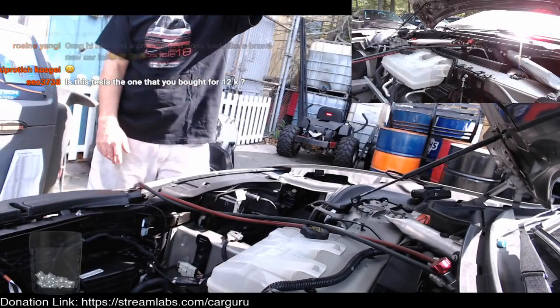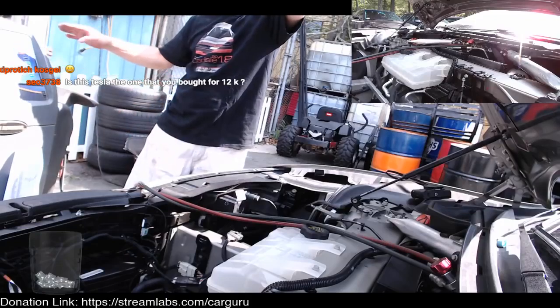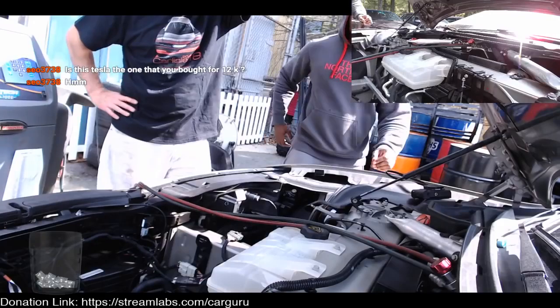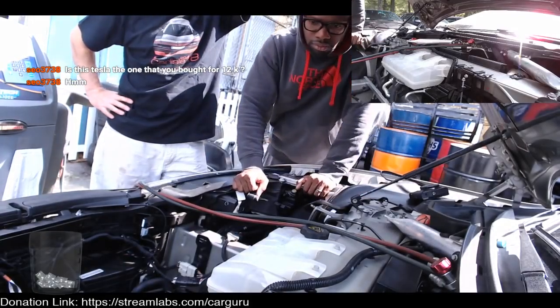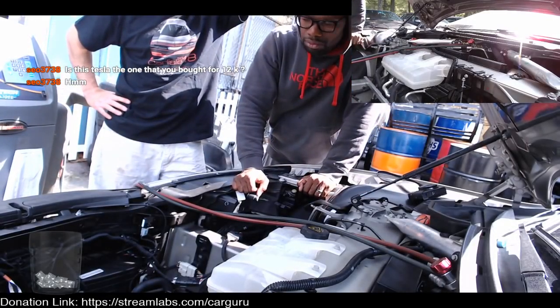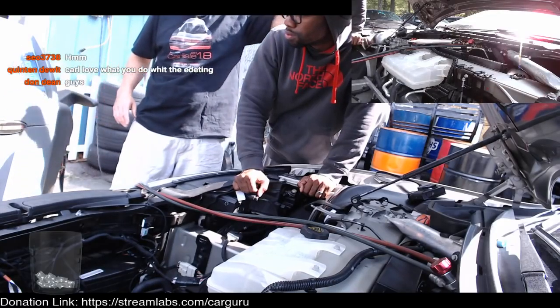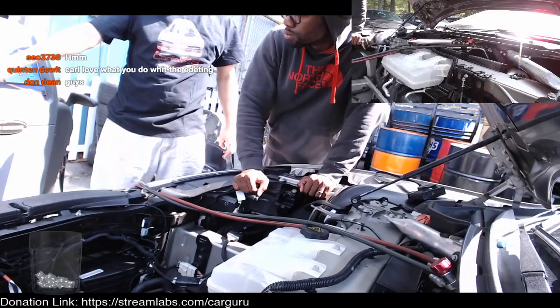We want to charge it, and it's going to apply a vacuum. It's going to make sure the oil is proper. It's measuring the oil that we're extracting out of this thing too. So we're going to inject the same amount of oil that we took out of it. It takes care of everything. It doesn't drop down fast, but it measures everything, every step of the way.